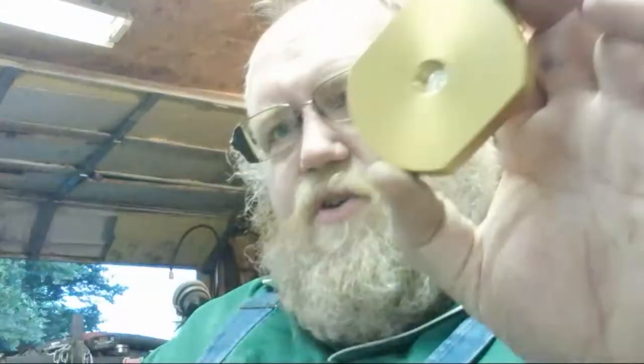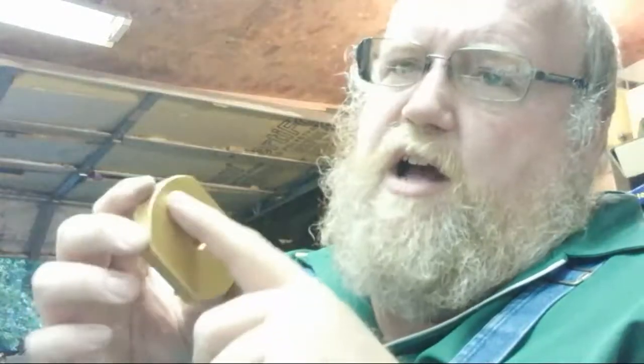So yeah, that's what it's for. You mark them, and that way, I found out the 4 plugs I did on the 383 already, all 4 of them point in a different direction, so the electrode's going all different directions. So once you get one set, then you can make a mark on here. Then you can just sit there and screw all your plugs in until they match. Sometimes you gotta go through 3 or 4 sets to get it done. And as sun faded as that was, it's been sitting around in the store for quite a while. Can't find a date on it.